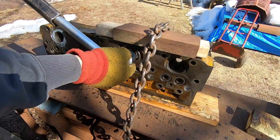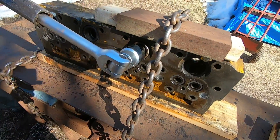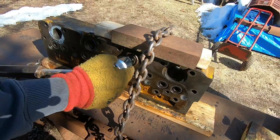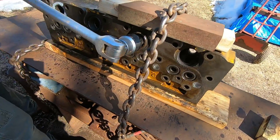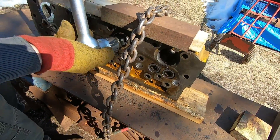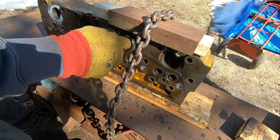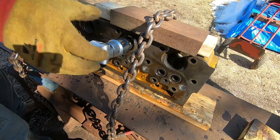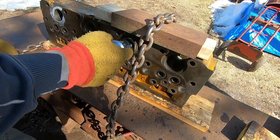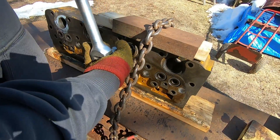We've had it out, run it back in, and now coming out again, working penetrant in. It's finally not snapping anymore — it's really tight but we're getting that penetrant into where we need it. Number three is just about out; she's turning easier all the time. Don't need the cheater bar anymore. Even if it's still a little stuck toward the top, it'll grind that rust out. Pretty sure the threads are out now — there it is.